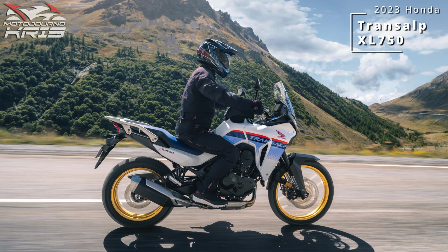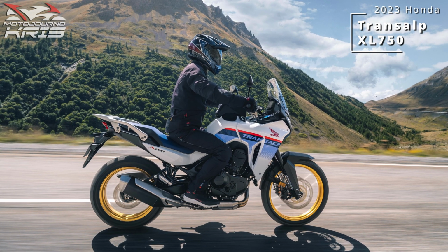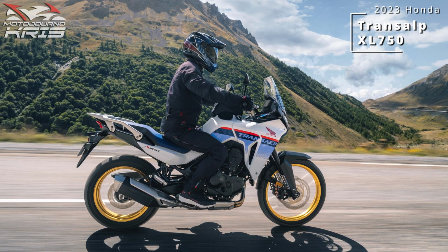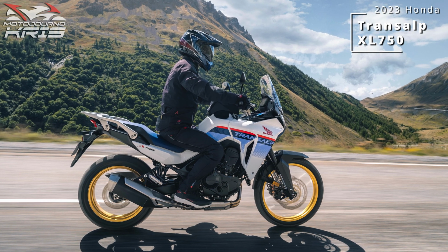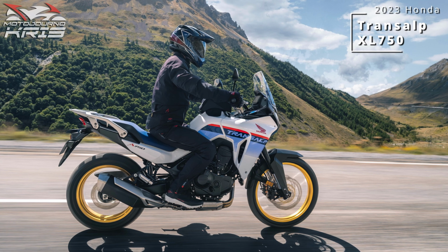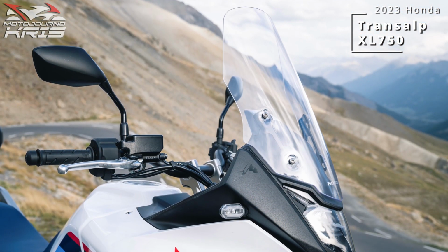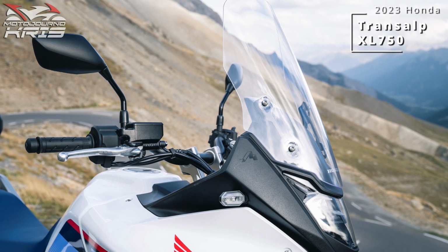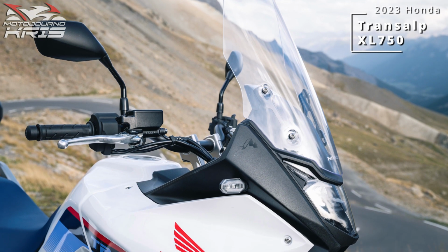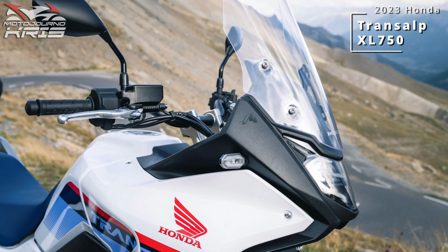Brakes meanwhile are a balanced setup with 310mm wave rotors on the front and dual piston front calipers. The rear is a 256mm wave rotor, and that's mated to a single piston caliper by way of comparison. No doubt a setup aimed at control over outright power. Spoked wheels are a 21 and 18-inch combo with a 90x90 front and 150x70 rear in tyres, with either Metzeler Karoo Street or Dunlop Mixed Tours fitted, and you'll be running tubes.